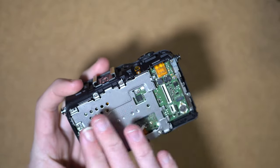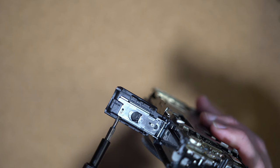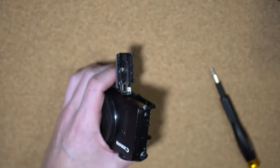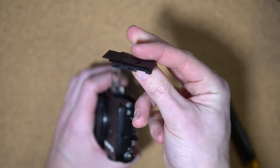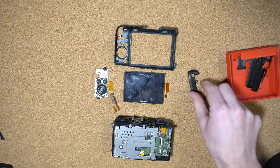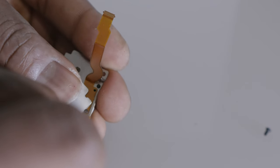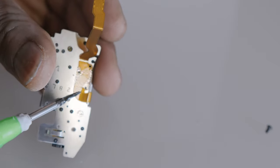After removing everything, you need to remove the battery cover door. There are two Phillips screws — unscrew them, the small plate comes off, and the large plastic piece comes off too. This is necessary to allow SD card access. You can store all these pieces in a box in case you want to reassemble the camera. For extra leeway in the belt, carefully cut the two small plastic tabs covering a ribbon — do not cut into the ribbon itself.